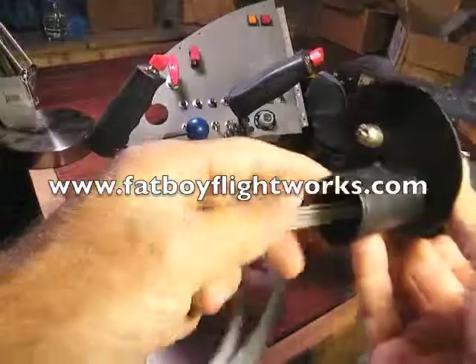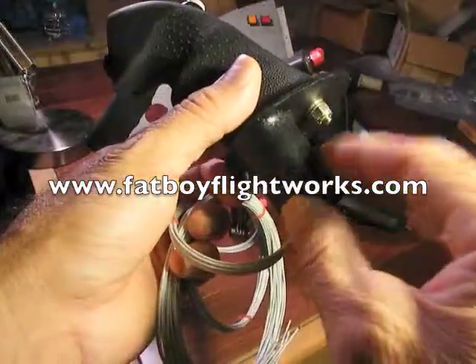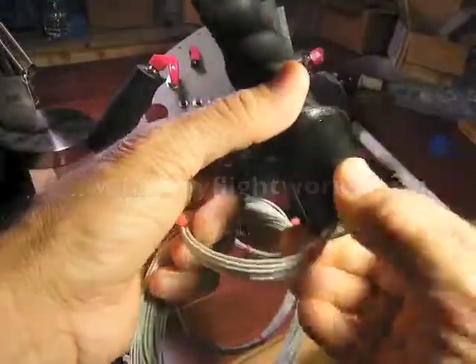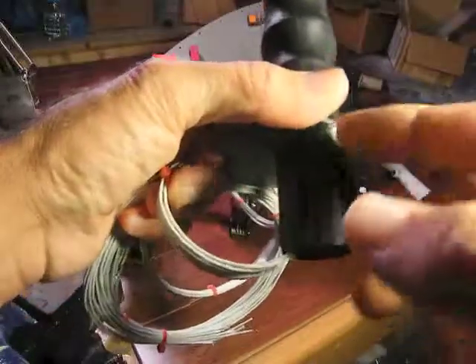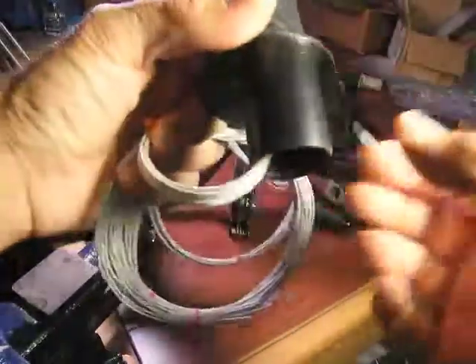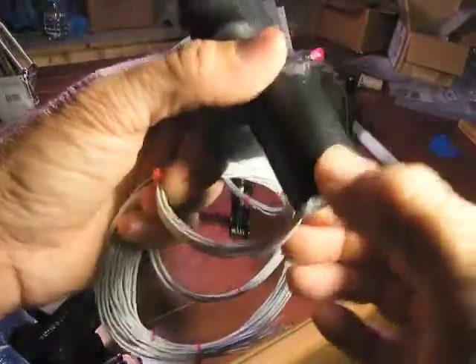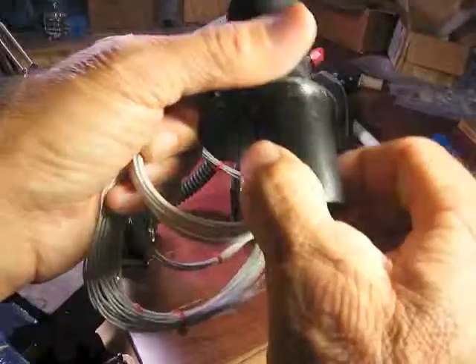You'll read different articles with builders talking about how they're fastening their grip to their stick. Some stick grips go inside the stick, some are outside. What I have my customers do is bolt it — one bolt east-west and another perpendicular to that, so you've got AN3 bolts going through your stick. You can also do set screws in thirds around the base sleeve — two or three different set screws — but my personal preference is to bolt on.